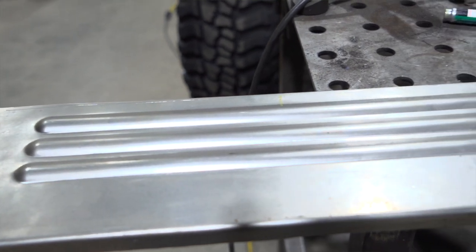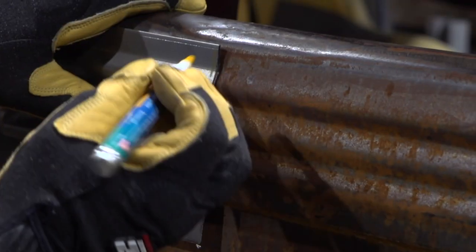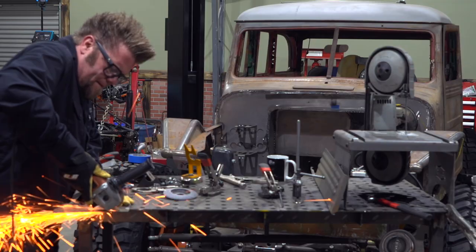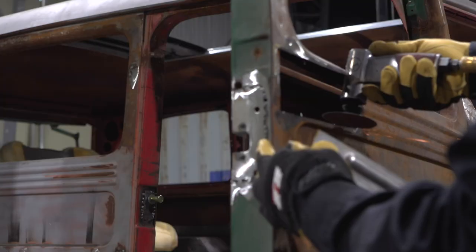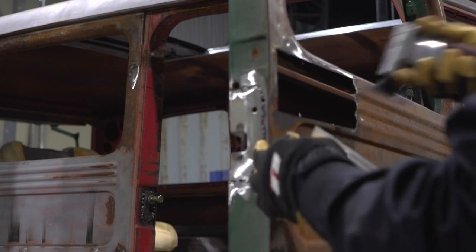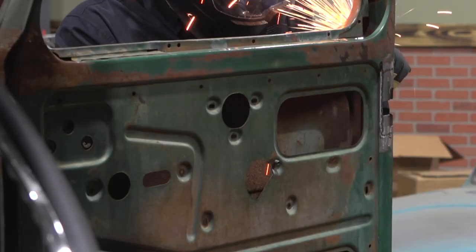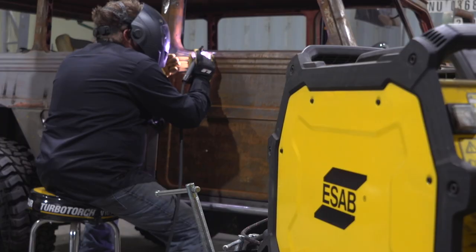Now I know that if you can, the best thing to do is put a large patch panel in place. I picked up a complete door lower patch panel for a Willys Wagon — it has the same body lines as the top of the door. I'll scribe it, cut it, transfer the size onto the door, mark it, cut it, and grind it until it fits perfectly. I want a butt joint — no overlapping. Once it fits, I'll tack the whole thing with the MIG welder, grind it off to check it, then go back and fusion weld all the edges with the TIG. Then grind it down, metal finish it, and it'll need just a very small amount of filler. It's going to look damn cool.